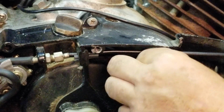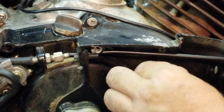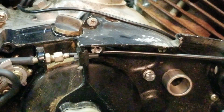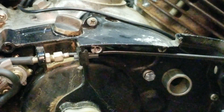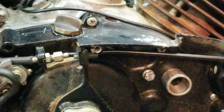You're not going to monkey tighten it. You're just going to snug it up. Like you would anything else. Okay? And the head on that is going to be 10mm. The reason for this is to literally block off so no air is sucked in. Okay? Because you don't want to suck air in.